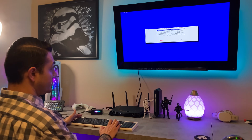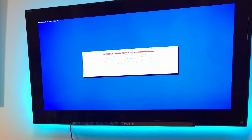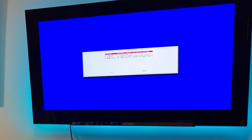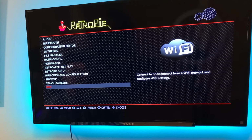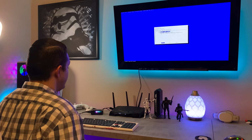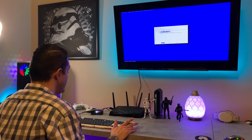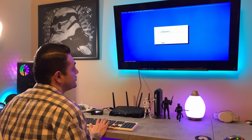So in order to get your network set up or your Wi-Fi, you do need to come down to Raspi config here, and then you will go to localization options and set your country, because by default it doesn't know where you're at. You can also set your time zone, and then once you have done that, you can go down to this menu here and go to your Wi-Fi and set up your Wi-Fi network, which we already have done there. As you see, we're set up to Damn That's Good Internet. For navigating this menu, you will need a keyboard. This is a $9 keyboard on Amazon. I'll have it linked in the description below. And you probably will also need a little wired mouse as well, just to navigate initially.